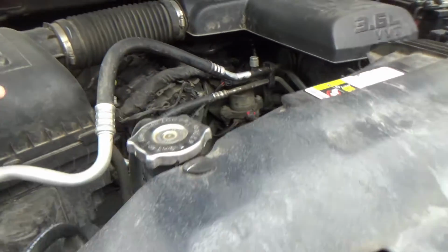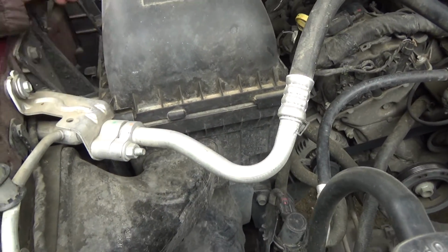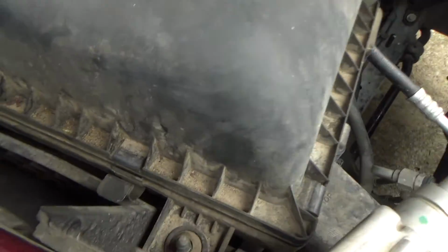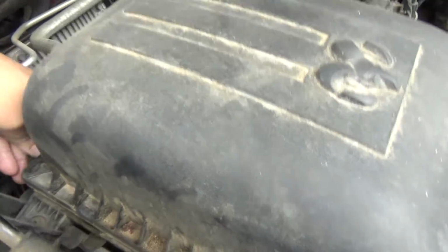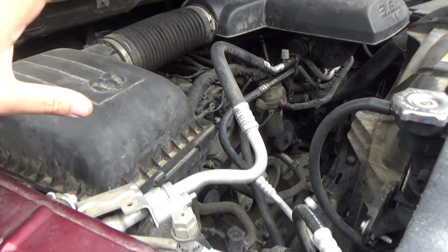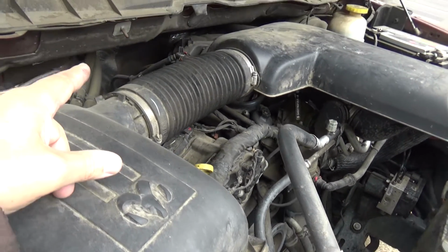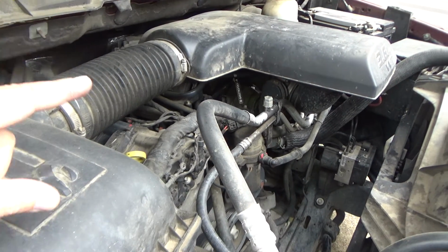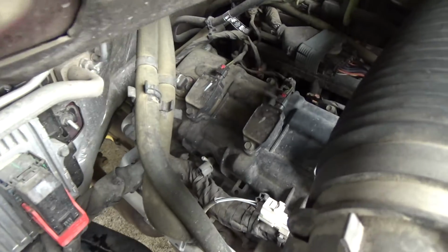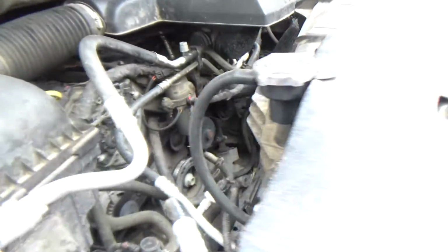misfire. First thing we're going to have to do is get this airbox off, and it looks like all we're going to have to do, and this will be my first time doing this, so I just slung that across the engine bay. This will be a good gauge for someone that has never done their own, how long it's going to take. Now, you need to be aware the intake's got to come off for the driver's side coils and plugs. You can see the coils and plugs on this side. Going to be very easy to get to once we get this airbox out of the way.